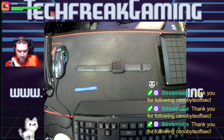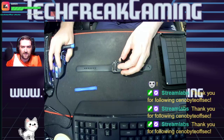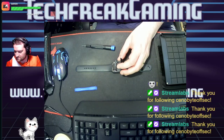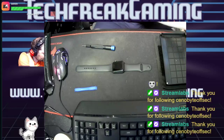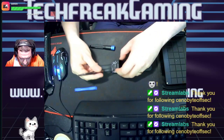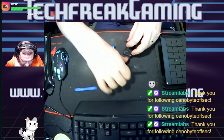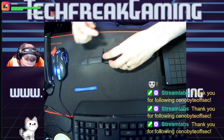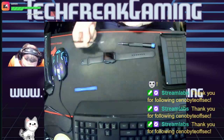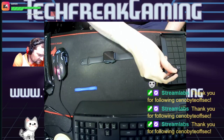But then again, that is actually holding a little flap. That little flap there is what allows us to remove the plate that then allows us to connect to the battery on this particular product. It does say we require some tweezers. So just going to get our little needle nose pliers. And it looks like we need to actually completely remove this. Now again, we're going to have to be very careful as we take this off. So, no brute force and ignorance on this one. So there we go. There's our little battery door. So we're going to pop that into our tray.